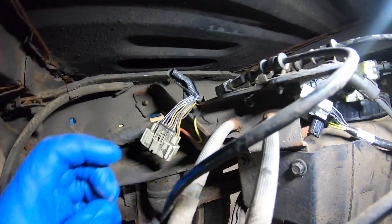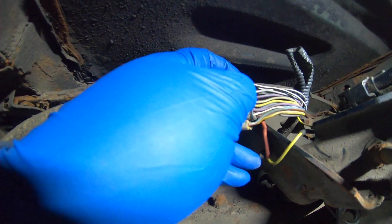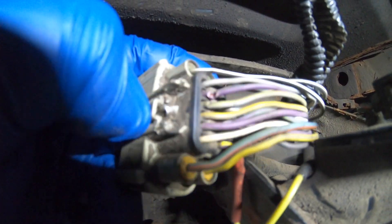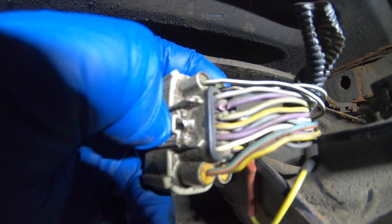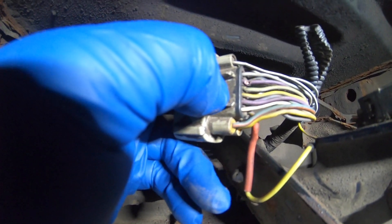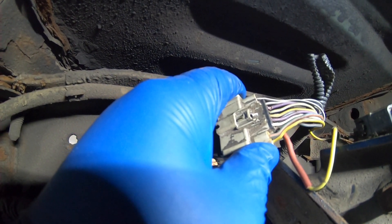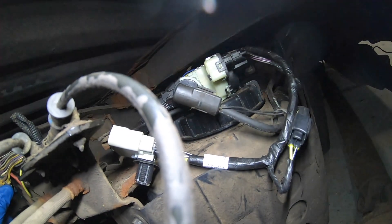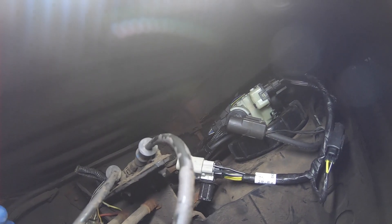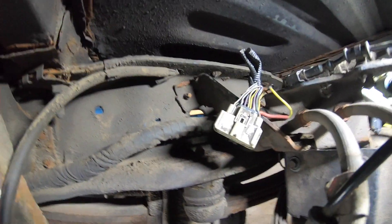Back on this 2011 — I fixed the one wire but there's another check engine light. Right on my thumb you can see the purple wire's got a pretty good cut in it, and there's one right below it — a gray one — same thing. We're going to repair those. The check engine light is off right now — it might have wiggled into just the right spot. I also got a new wiring harness on top of the tank because the big plug cracked and I wasn't happy with the connection.